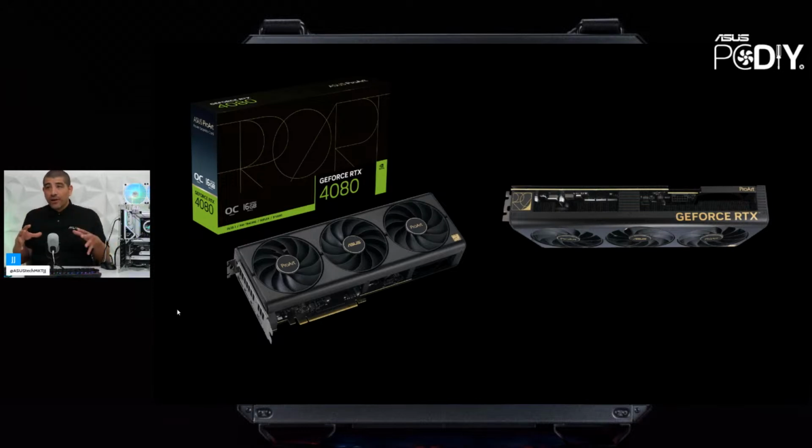But in terms of our internal testing, that's what we've generally seen under an extreme, very heavy load with FurMark, which, like I said, is not representative of normal application use or games in either scenario. So generally you would probably see temperatures below that 71C. But if you want to use 71C as that very, very heavy load reference, that is nominally at around 44 dB. So overall, definitely this still meets the mantra of what our goal is in terms of a card being cool and quiet and performant.